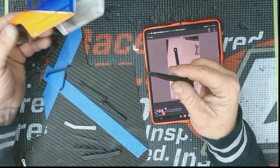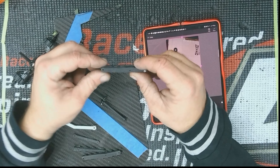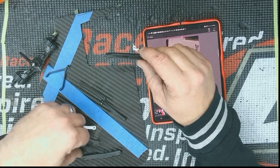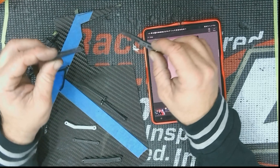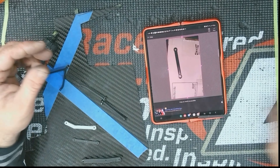Once I got my body on there, after a while I got tired of it looking so funny, and I think it'll help performance a little bit to shorten it up. I'm not just trying to climb straight up hills, so I shortened these — took 10 millimeters out of them — and it seemed to help a little bit, but I broke one of them. Not by fault of the person who made them, but because I modified them. So I decided I was just going to make my own links.